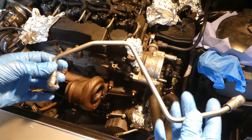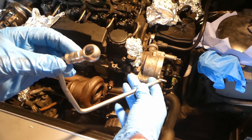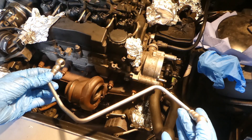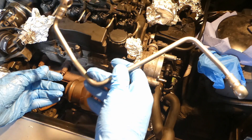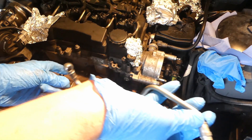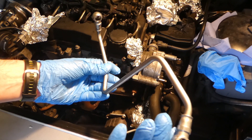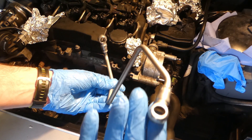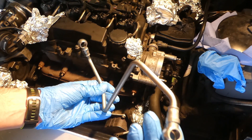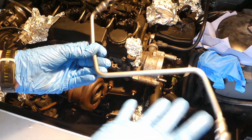Another thing is the actual oil — the pressure oil that comes from the crankcase, from the filter. That's also there. What I'll do with that is put my finger there and blow the whole thing. You can reuse the old one, but I'll be using this new one in case there's anything inside, though it's fairly unlikely. I'll have a spare for that one.